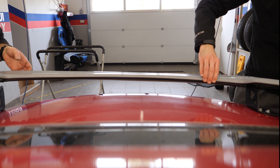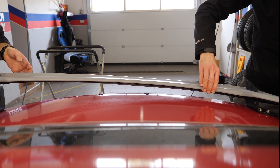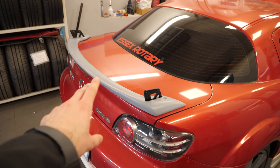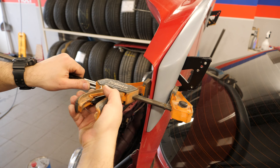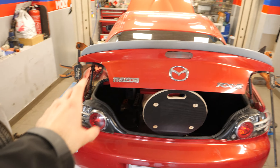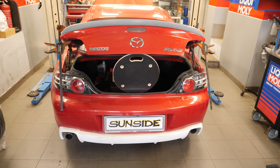Now it's time to carefully position the spoiler on the boot. Firstly, we have to get the brackets through the slots, and once both sides are through, we can press it down. The spoiler is now attached, but this side is not sitting down properly. To fix this, we're gonna press it down with a clamp so that when it dries, it will be perfectly attached to the boot. The spoiler is now mounted and all we have to do is wait for the silicon to dry and attach the upper part.